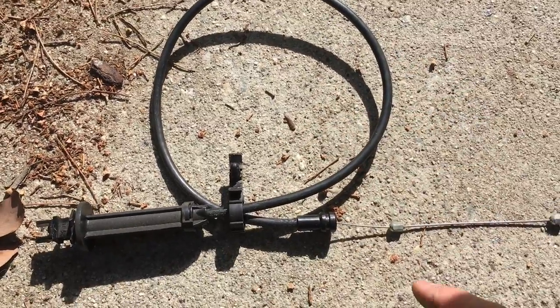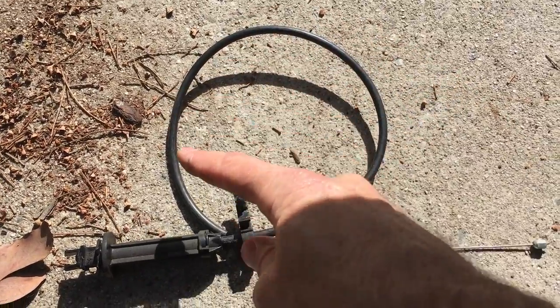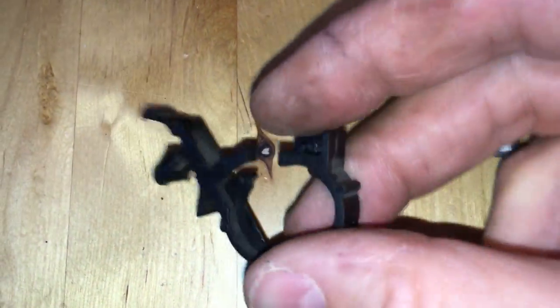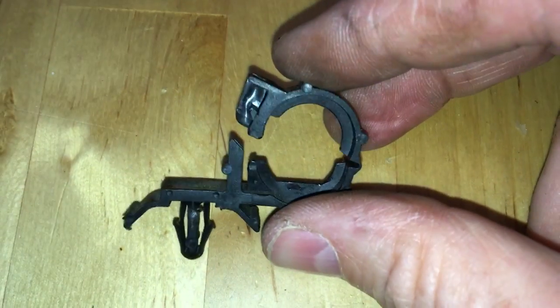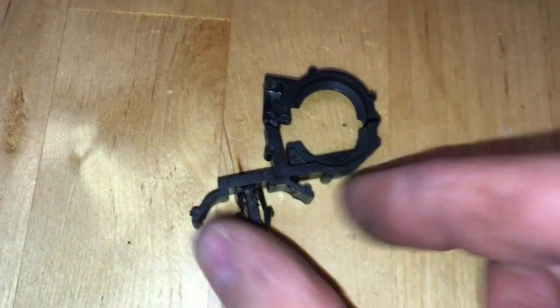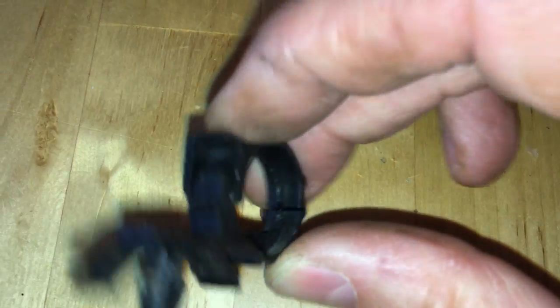Here's a look at the whole thing after it's been liberated from the truck. It goes up under your dashboard in a circle, held on by this clip — that's the unit. Here's a close-up of that clip. I twisted it sideways and popped it loose. Rather than fighting with it under the dashboard where you'd likely break it, it's easier to just squeeze it with pliers, push up on it, take the whole clip out, and then figure out how to open it.